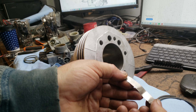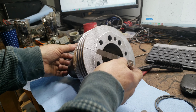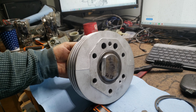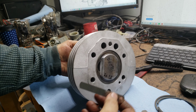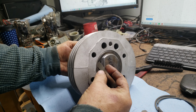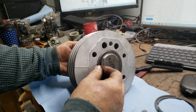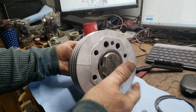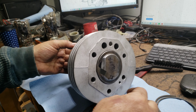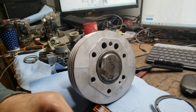The first one is .05. This is generally how the piston is going to get lined up. Here's the intake side, here's the exhaust side. I am checking. It's at least .05, but the minimum needs to be at least .055. The best scenario is to check .06 or .07 millimeters, but I don't have that.